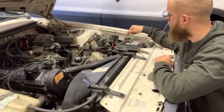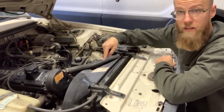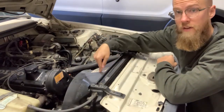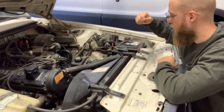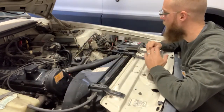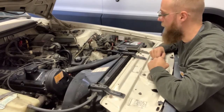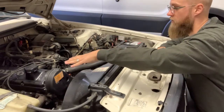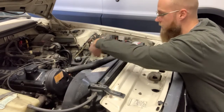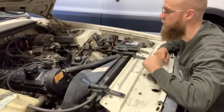The first step is going to be to remove the battery. We're going to drain the coolant, remove the upper radiator hose, lower radiator hose, the radiator fan shroud, the fan, and the coolant reservoir. That's step one — get the coolant out, get the coolant components out. That's going to give us access to everything else. The next step is to take off the timing belt and other belts, then we'll start on the intake manifold and finish off with the exhaust manifold.